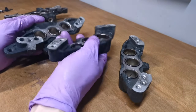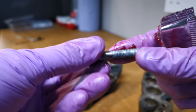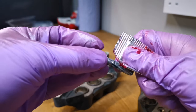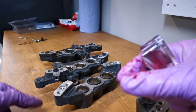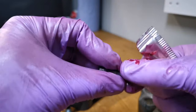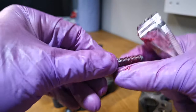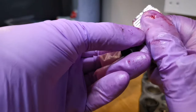All in, so we'll get these stuck together now. With the remainder of this grease, I'm just going to put it all over these retaining bolts, because I don't like to waste things. It'll only go in the bin, so let's get these nice and protected. Don't want them seizing into the calipers. Not that I probably will rebuild these calipers ever again in my ownership. They'll last a long time. And I'm assuming that these old seals, what I've taken out, are factory fitted.